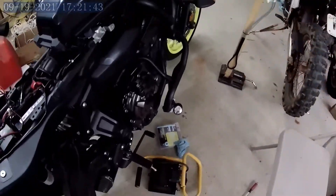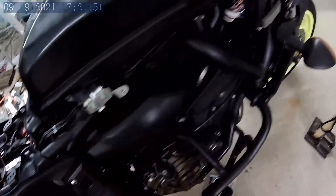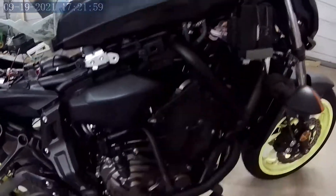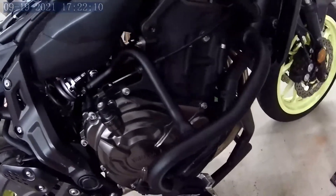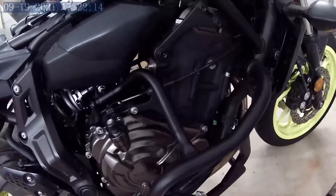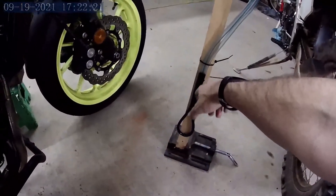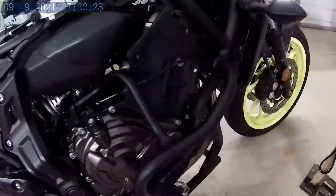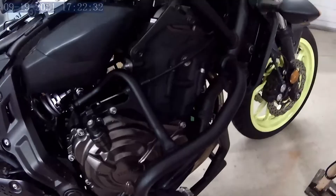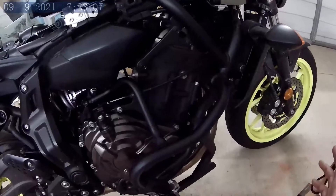You actually don't have to take the tank off the motorcycle — just take the tank bolts out, leave one loose as a pivot point, and put a four-by-four block under there so you can get access. You want the bike to get up to operating temperature; I let mine get up to around 200 degrees before adjusting. Rev the bike a few times, let it settle back to idle, adjust, rev again, and after a few cycles it should come back to very close to even. If it's slightly different, that's fine.